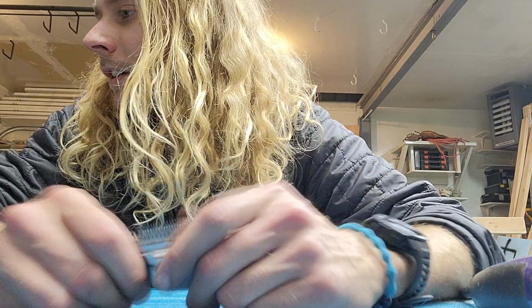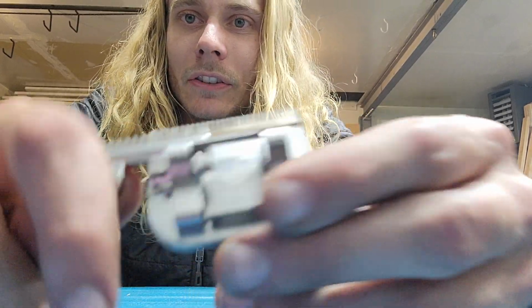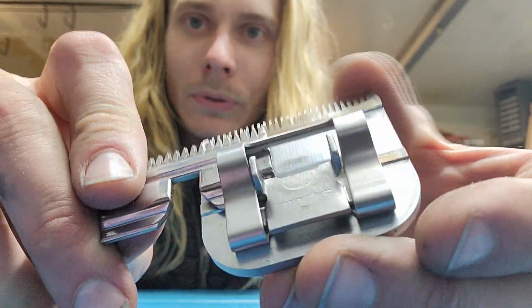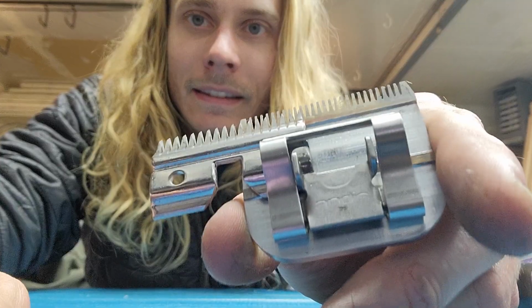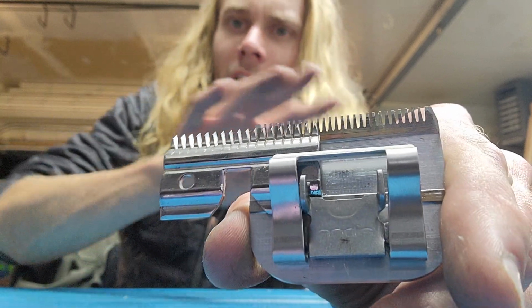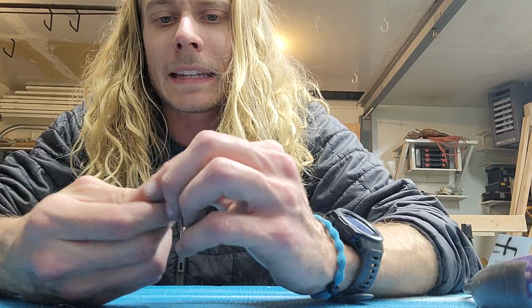There's no blade in here that wasn't overdue. There was one that wasn't even used, but that one doesn't really show you the wear marks either. Anyway, you can see that. So when you see all that shiny stuff on the blade, it's worn out, it's dull, it's flat. There needs to be a hollow ground. That's why you get that rainbow effect on it. So I hope this makes sense.